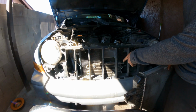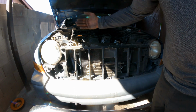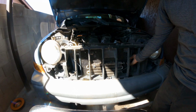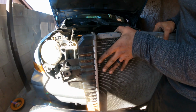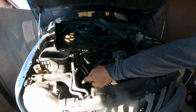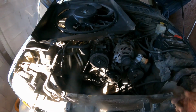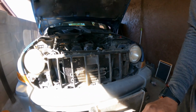Yes, when you don't have that external cooler, what you're gonna do, you're gonna lift the condenser and you can slide it, or you can do this because you have plenty of room. The hoses here give you enough give to do that. But in this case, I was not able to do it. So I needed to lift this corner high enough to go over the metal, the curb right here. As soon as it went over, tilted, move that hose, and comes up. Okay, you should not have this much challenge like you saw me on the video.